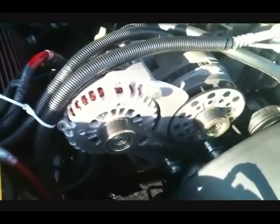Like I said, this thing is doing me right. So I want y'all to understand — I'm about to explain it a little bit better. This is the alternator that runs the truck, separate from this one. This one, the new one, is externally voltage regulated. It's the voltage regulator over here that runs that high output alternator. It's got a little knob in there — I can adjust it to wherever I want the voltage to be at. I can take it up to 18 volts if I want.